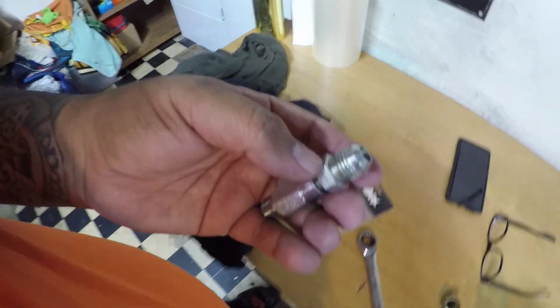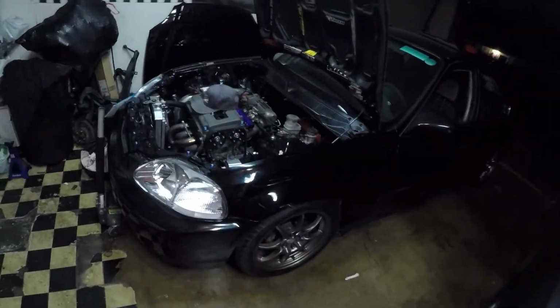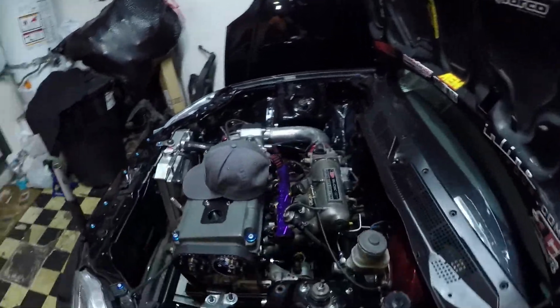Once I figured out that the bung itself wasn't on too bad, it was actually really quick to take out. So I'm going to put the oil pressure switch back and then put on the sandwich plate, and we should be good to go. After that, all I need is oil. So let's get that buttoned up right now. It's pretty much buttoned up. I tightened everything.